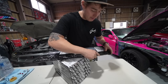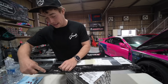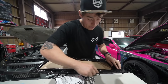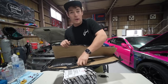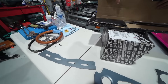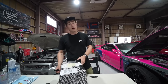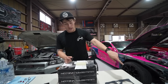We're going to start with this. This is going to be Sam's job today because, you know, I'm a good welder — I can weld a couple things, I got a stud out yesterday — I'm just not the best at it. Sam has been practicing a lot, and honestly Sam's a pretty good welder, so we're going to have him do this portion. So this is the subframe reinforcement kit right here. This ensures that your chaser subframe is no longer going to crack. You don't have to deal with any dramas. You can just put this up, weld it up, and you'll never have a problem anymore. There are smaller miscellaneous ones right there. So after we open all this stuff, the first thing I want to do is clean the subframe — maybe scotch-brite it up a little bit — so when Sam gets back he's just ready to go to town and we can start welding this thing in.